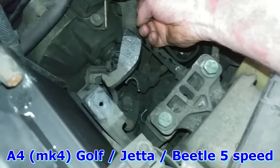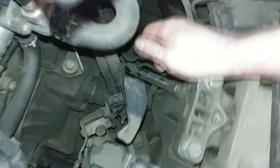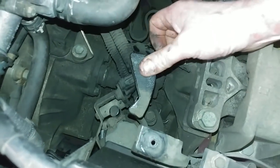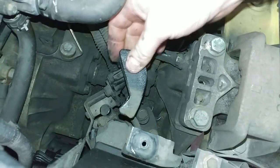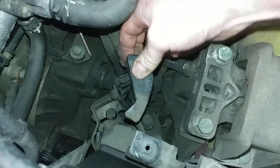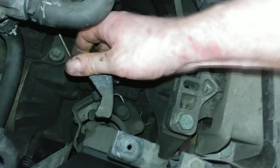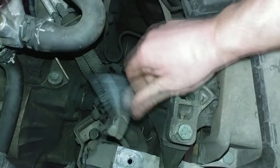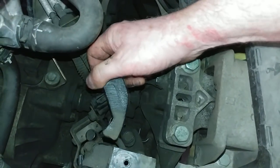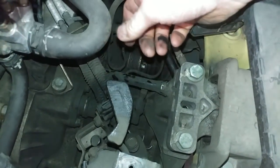I've got a 5-speed transmission with a broken shifter cable. Somebody else recently had trouble figuring out which gear they were in or how to interpret gears. So you can see this shifter or selector rod is spring loaded, so in its free neutral position, if you go in one direction, then come back to the middle, and then go to the other, that would be one gear. There's neutral, there's the other. So in its free position, it goes up and down.